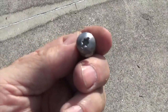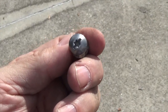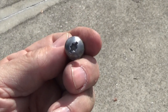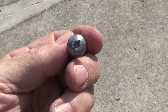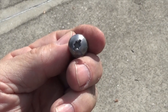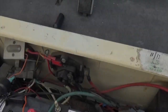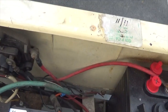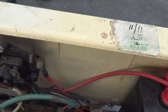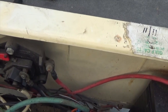One thing I found when I was removing the 2 bolts from under the forward reverse handle is that they had an unusual head, a combination Torx and flat screwdriver. So be aware of this, check yours carefully. It'll save you some time and effort, because a Phillips screwdriver doesn't work very well. When removing the forward reverse knob, remember to capture the nuts on the opposite side and save them.